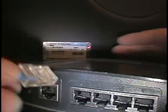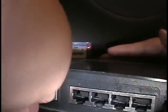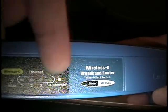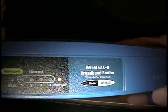What I'm going to do right now is unplug the Ethernet wire from the modem, and then connect the blue wire coming from the modem to where it says Internet on the router. If you turn it around, the Internet light should be blinking, which means your Internet connection is working.